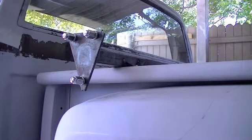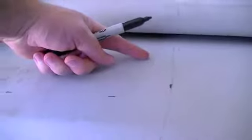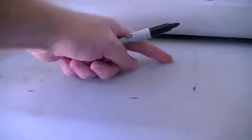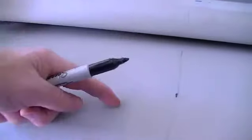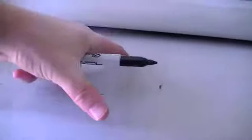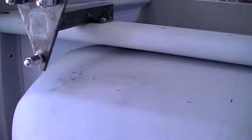I have to apologize — I'll have to pick this up and show you because my tripod is just not tall enough. So we've got marks along this line and I'm going to measure off of it. We know it had 5 inches of backspacing, so we'll go 5 inches back. And we know that the overall width of the tire sidewall to sidewall was 9 inches, so we'll measure 4 inches in front of that to get a total of 9 inches. I'll keep making some marks and then we'll start cutting.